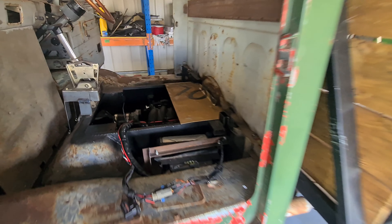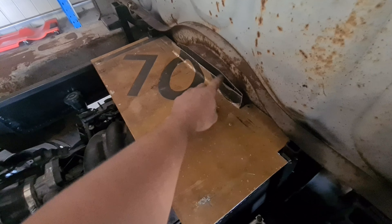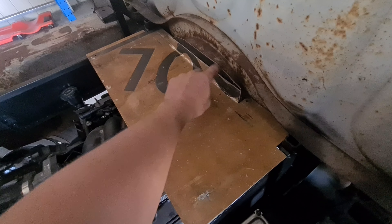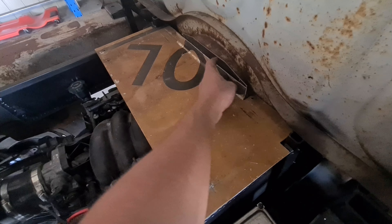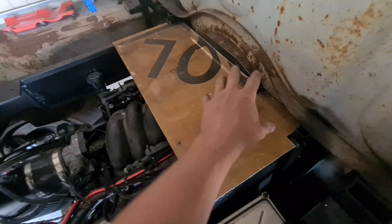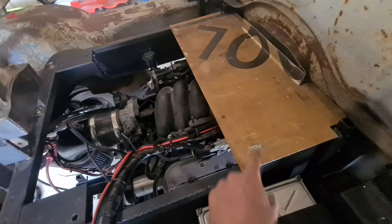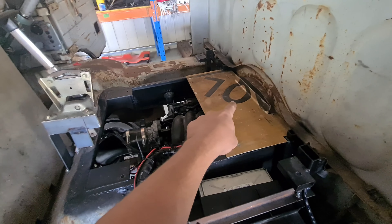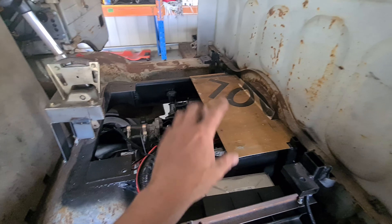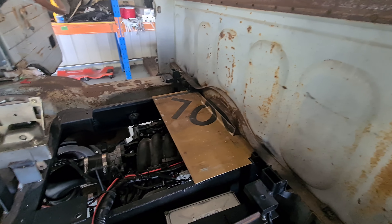A lot of cutting later — we've got the back section in. It's not quite tall enough, so I've had this other piece that I chucked in there. That'll be screwed together and I'll just silicone all of this so it's nice, attached, and also removable, but sealed. I'll chuck some fixings in here, same on the other side. Obviously that's ally and the truck is steel so I can't weld them together, and I'd also like it to come out, so it'd be good to just run some silicone down the back.